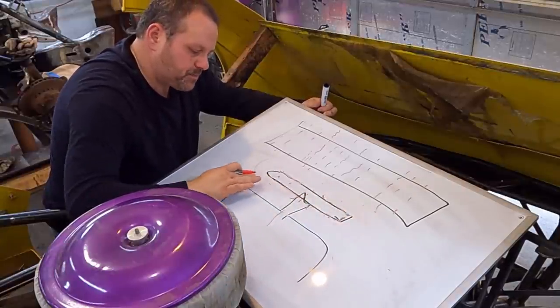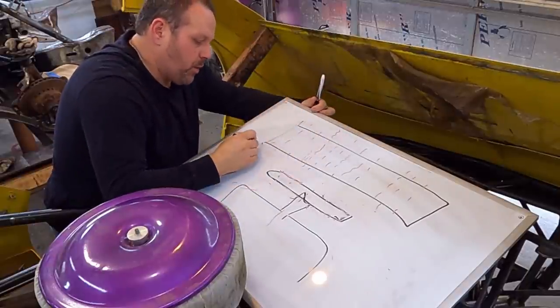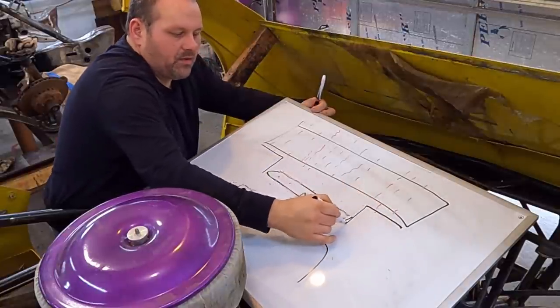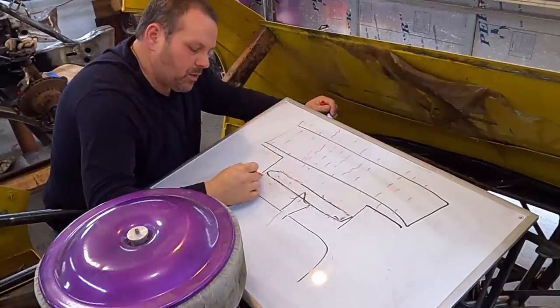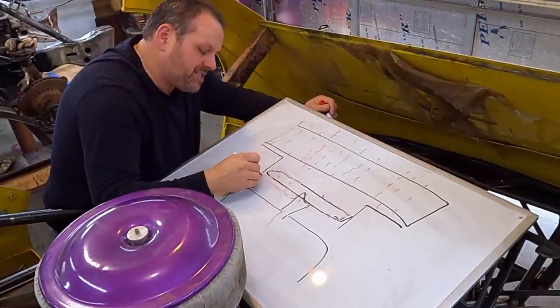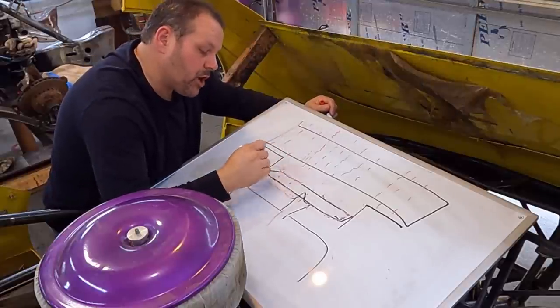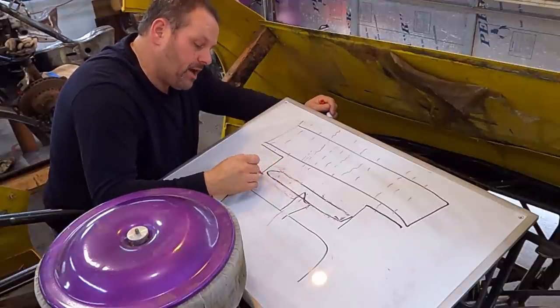Well, that's the reason for a shroud, okay? Because when you build a shroud around this, what you're doing is at high RPM, when this compression is happening right here, you're closing off this path for it to travel, okay? So you no longer have this compressible air that's at high pressure right here having a path.